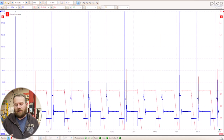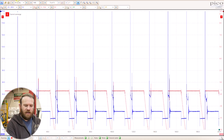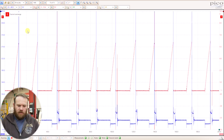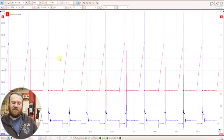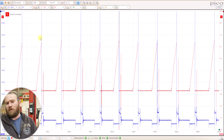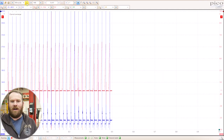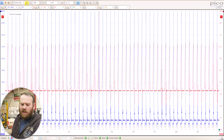We can see that my amp clamp is backwards, but on the ignition primary I am on the control side and I can see that information — though we're going off the screen. I'll bump this over to our other scale that goes up to 400 volts. I also hooked the amp clamp to the other lead. Since this is an eight-cylinder engine, I want to make sure I have at least eight cylinders on screen. I'm going to go ahead and stop our capture, shut the vehicle off, and we'll talk about this.